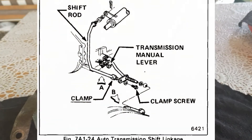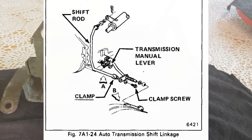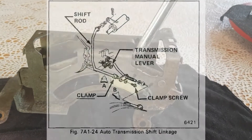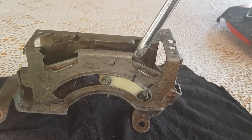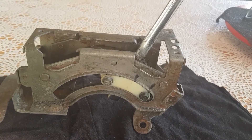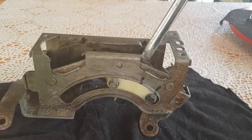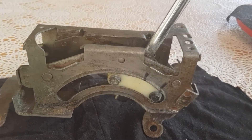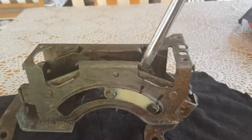If you've changed your motor or the headers or anything else like that, there is a steel rod that goes up behind the firewall and it connects to a linkage which connects to your steering column at the back, and that operates your reverse. In my Firebird, although it says there is a neutral safety switch, I've been right under there and I've tracked the wires. I cannot find either of those, but for the sake of my alarm and the sake of my reverse, I'm going to customize on this one.